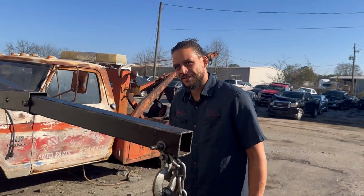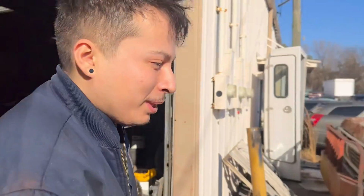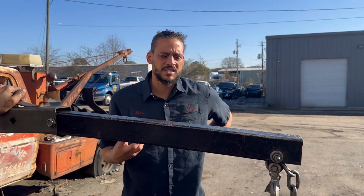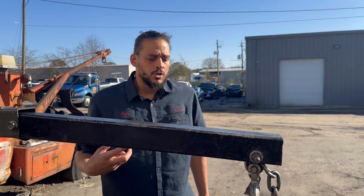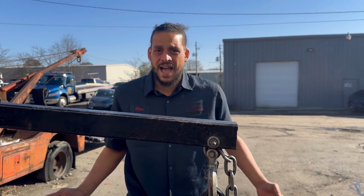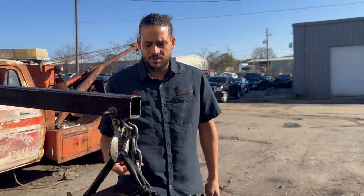Anything I'm missing, Raphael? What you normally stay away from when you pressure washing? Vacuum lines? Yeah, vacuum lines is another important one, because on certain vehicles, sometimes that stuff will be brittle, or it could have a hole in it that you don't know about, and you sitting there blasting it with a high pressure washer, you can destroy the vacuum lines. So that's another good one.